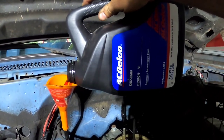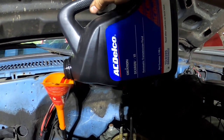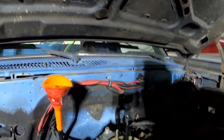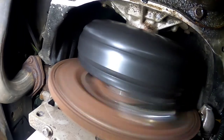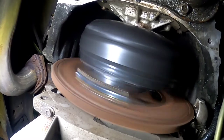You know what this means - we're getting really close. Getting it all topped off with some fluid, making sure it's not bleeding out. Let that run down the tube so we can check it in a second. No massive puddles under the truck - so far so good. Converter is nice and sturdy like it should be, bolts look like they're doing their job, and the front seal's not leaking out of the pump. Looks like we did something right down here.